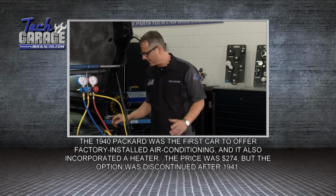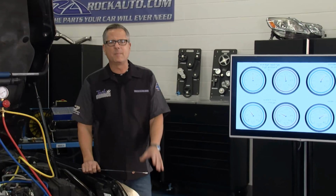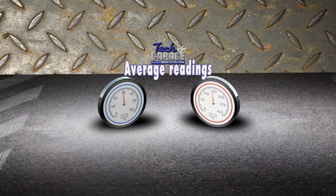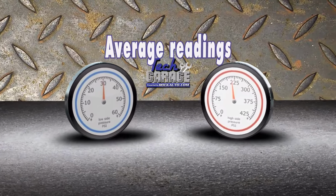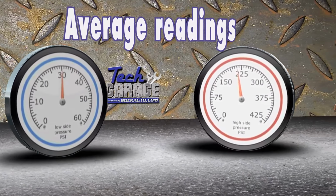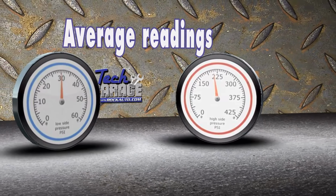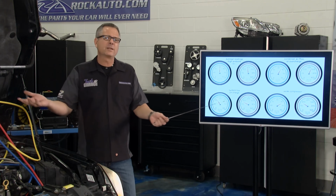Yeah, you know what? Gauge readings are key. I have a couple of gauge readings right up here on the screen, Brian. Perfect. And this is going to help anybody out because it doesn't help looking at the gauges unless you know what you're looking at. So right here, we actually have the average readings. What should it be? The systems today with the refrigerant in there should be around 30 on the low side, up to about 175, 225 on the high side. The compressor's pushing, it's pulling it into a vacuum. Everything's good there. Now, ambient without it running should be about ambient temperature, whatever the temperature is.